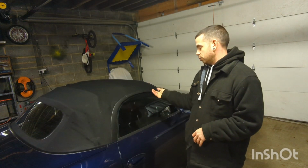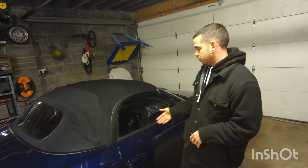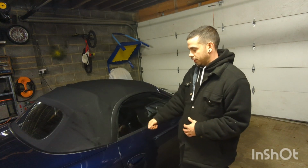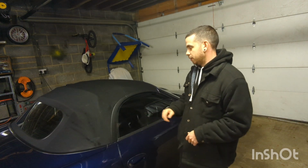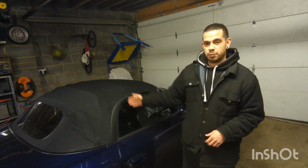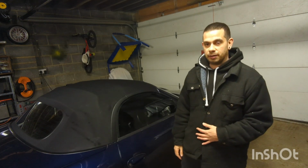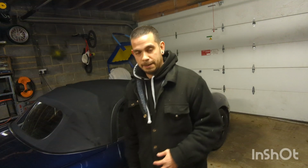And if you want to get to the front of the engine, seats all the way forward, similar thing, you lift out the carpet in the front, and there's a few pieces for it explained in that video as well. And you unscrew the panel that's bolted in behind, and then you can access the front. Learn how to do it, you might need to one day.